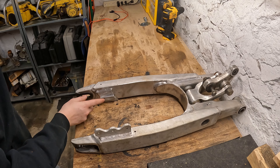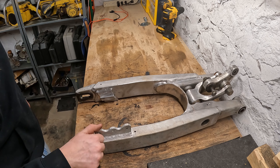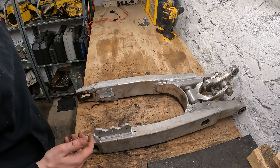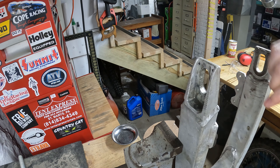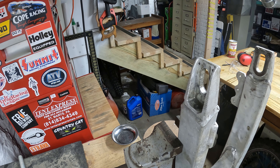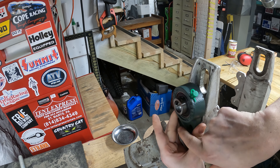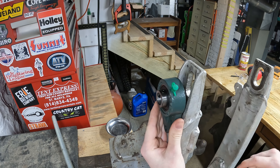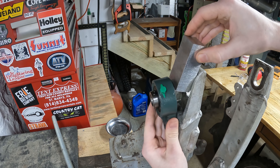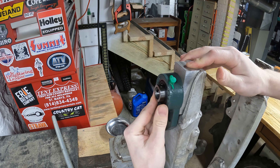This bracket here is where the rear brake caliper slid on, but it's creating clearance issues for us so we're going to take it off. This is where the chain guide mounted — I'm going to leave that on because it's not in the way. First thing I'm going to have to do is grind off this weld bead so it's flat with the swing arm. Then I'm going to put this right at the bottom of the slot so I can drill out these three holes and bolt it on, but I want to support this gap back here — these are going to go in here and then I'm going to cut them how I need to.